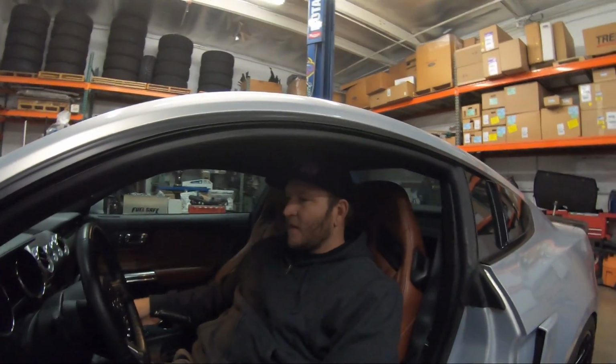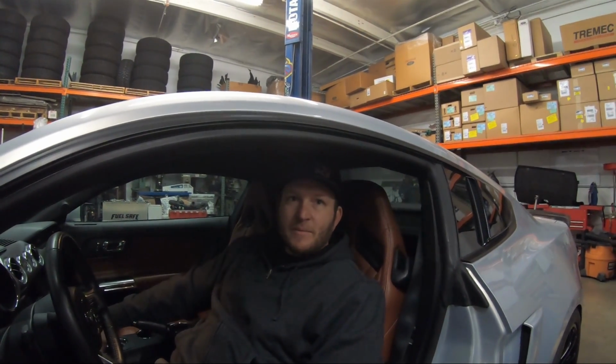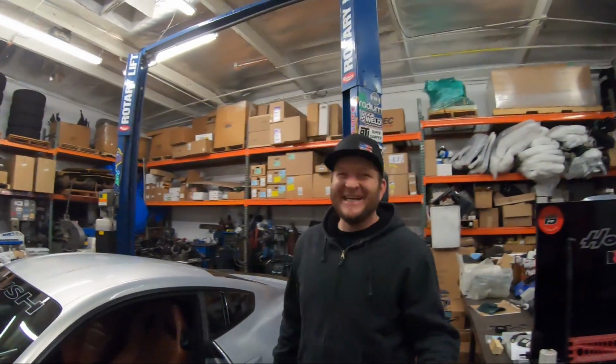So when I tune this for Justin, I'm gonna make sure I set the proper gear ratios in the tune so everything works correctly with the transmission swap, including stupid stuff like cruise control. So what happens if you do the swap and don't change those parameters? Nothing really bad happens, but your cruise control doesn't work and the computer can't infer the correct gear. That sounds pretty bad to me. I know. Hey, they don't always take me seriously.